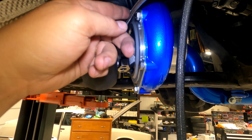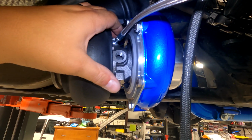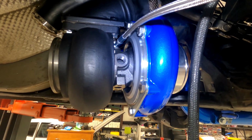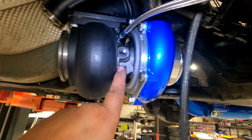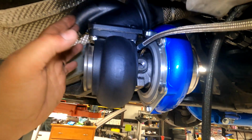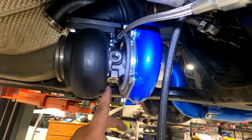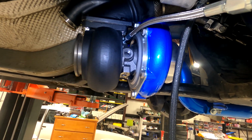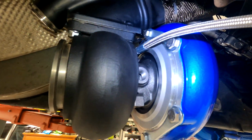And then I have it tilted towards the cold side here. You tighten this down with the washer on top, washer on the bottom, just standard banjo fitting, right? Then you need to put it finger tight again here. Put it up again, test fit it, lock down 1 or 2 of the screws to hold it tight, pull it back off, tighten all the hot side ones. And then you can finally put it up for good.